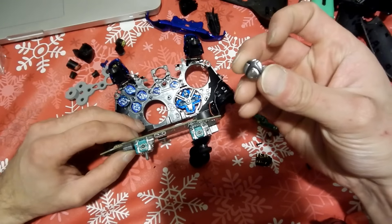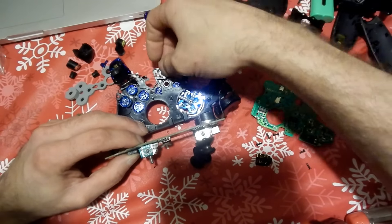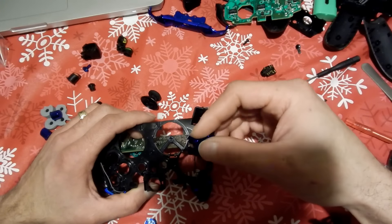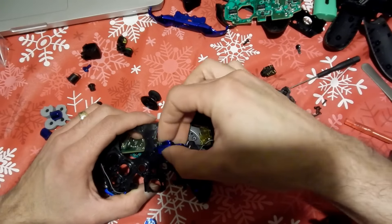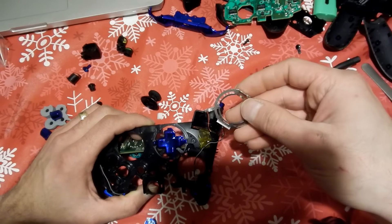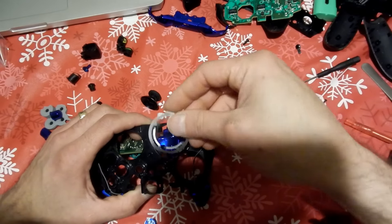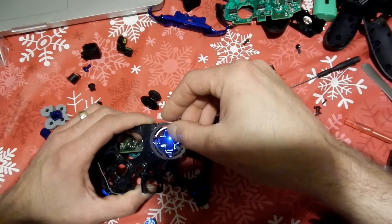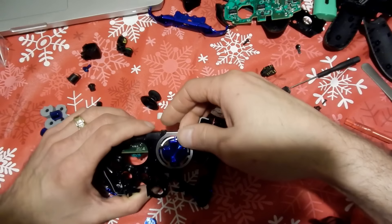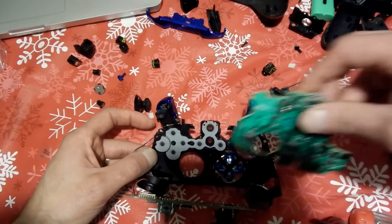While you have the rear assembly open, you always want to make sure that guide button is in place. I'll show you how to put the directional pad into place — the digital pad. Basically, there's a certain unique groove that faces towards the bottom, and the metal clip goes in only one way. The wider part goes towards the bottom of the controller. After you snap the top of it in towards the top, that's how you pull it out too. It snaps into place and it's already in — it's real simple.